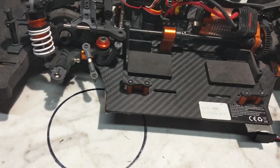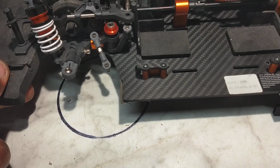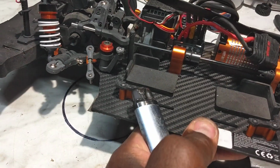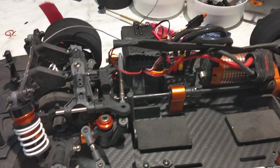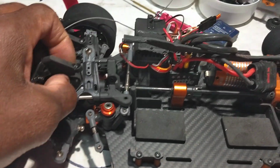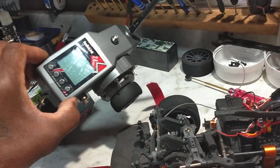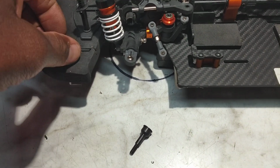Hey guys, anyway man, I decided to shoot another video so you guys will know what actually happened on that wreck. So I'm gonna make this part two. But just like I thought, now initially I thought it was me. I thought it was me at first, because I know I cranked my servo up to a higher voltage. So naturally, when you do that, your servo is going to be quicker, and I didn't adjust it in my transmitter to slow it down. But that wasn't it.